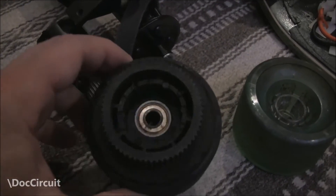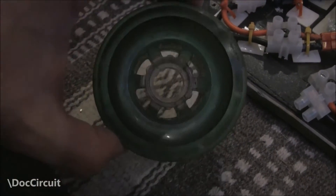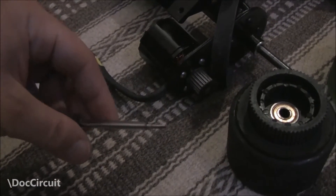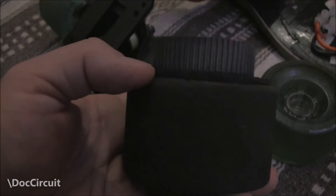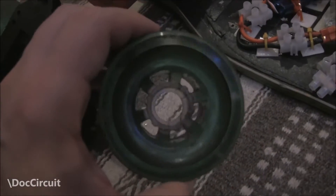But this isn't as difficult as you'd expect. That drive cog literally just slots into the spokes — it's got centre spokes and the drive cog literally just slips into that. To take it out, a simple flat-headed screwdriver will prise that off. Just be careful you don't bend that flange because the belt will rub against it — you want to keep that flat. But yes, it will come out quite easily and will slot into any wheel with that centre spoke arrangement.